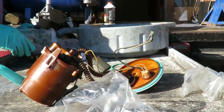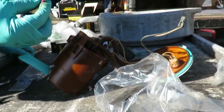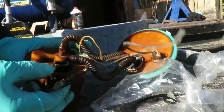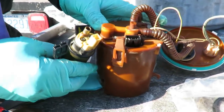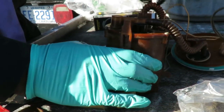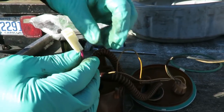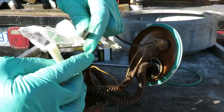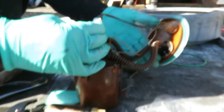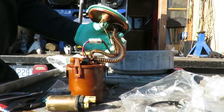With the new fuel pump, they give you a little harness adapter. This is the precision pump — the connector on this pump is different from the original. You've got to use the harness they gave you, plug up the new fuel pump until it snaps into place, and this end is going to plug up to the harness of the module. That is done. Now we can go in and set the whole module back into the tank.